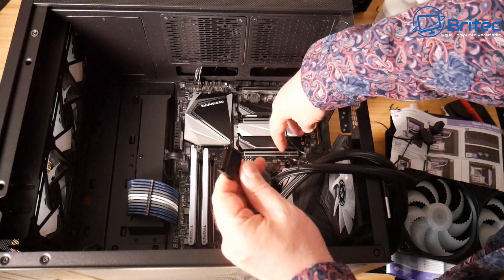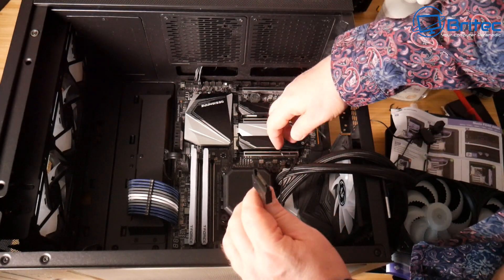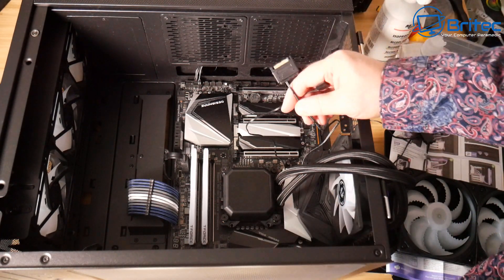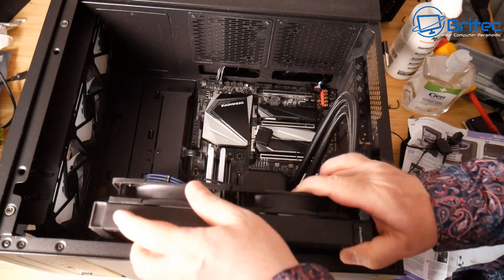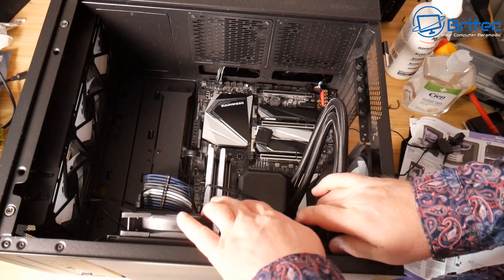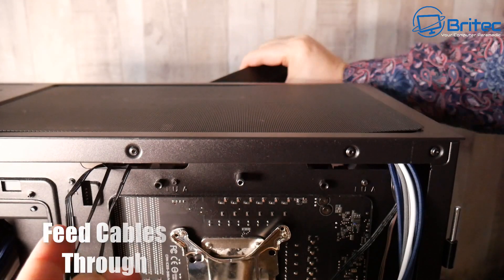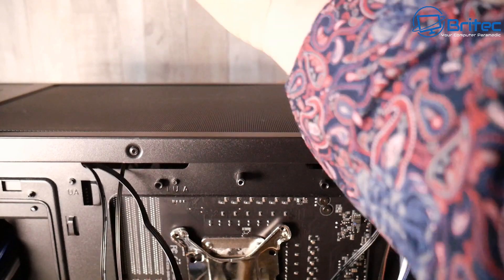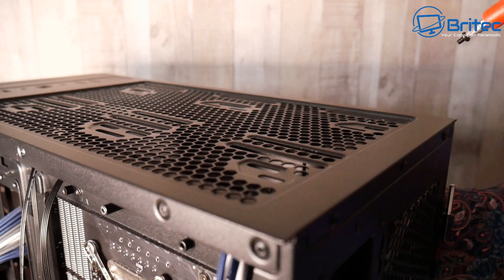Once the pump is on, take care of the cables by tucking them through depending on how you like to wire things up. I'm going to tuck mine through and bring them back round from the outside. The SATA cable is for power and the four-pin connector goes to the pump header on the motherboard. Now let's get the radiator lined up — I'll tuck these cables through at the top and then plug them in. Once it's lined up I'll lift the PC to show how to screw this in. Once all cables are tucked through, screw down the radiator. Don't over-tighten — they're only small screws but there are plenty to hold it in position.